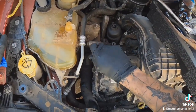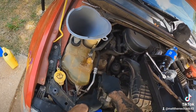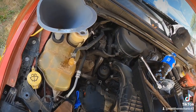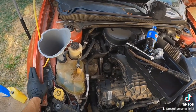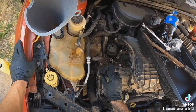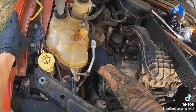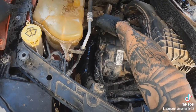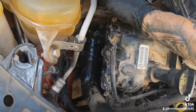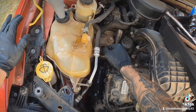So how you bleed these off is at the thermostat housing. We're going to crack this loose. You'll see this go down, and once the bubbles stop out of here, I'll go ahead and pull it all the way off so you can see. All right, so there it goes — it's starting to drink it. So any moment now. There we go. Oh, that's nice and spicy — by spicy I mean it's really hot. So you hear that? See those air bubbles? It is going to make a little mess, but it's what you got to do.